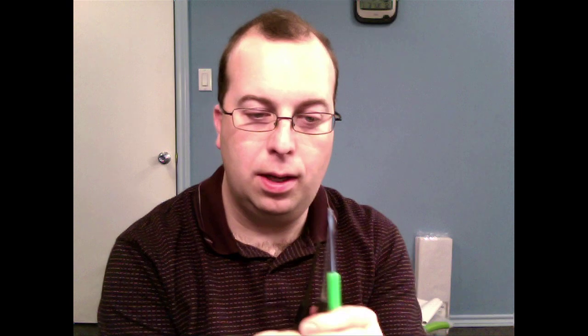Before you get started, you're going to need at least these three tools. You're going to need a T8 or T9 Torx driver — some iBooks use the T8, some use the T9, and there's no way to know. You're also going to need a very fine-tipped Phillips screwdriver, and then a Phillips screwdriver just a little bit bigger, so basically two Phillips screwdrivers.